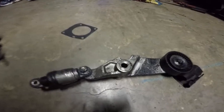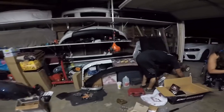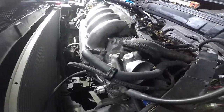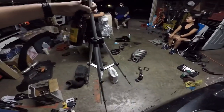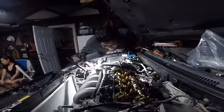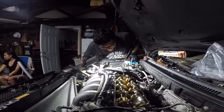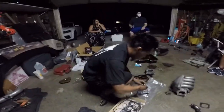So Marky Mark featuring in Rafa's video today. I installed the Celica GTS throttle body. Sebastian, where are we at? We got the timing chain cover off, oil pump is out - dropping in the MWR oil pump. We'll update you guys in a bit. Little update - had to buy a new belt tensioner because I broke the other one. They only had a 1ZZ tensioner - it fits but now the belt doesn't fit, it's a little shorter so there's no tension. Need a slightly smaller belt. Went to AutoZone and bought a shorter one - hopefully it works, bought two so one of them has to work.